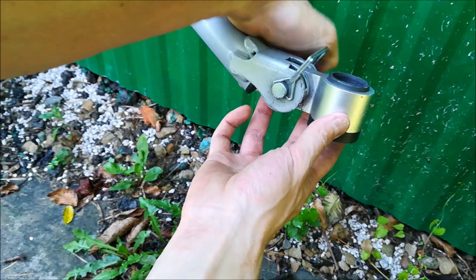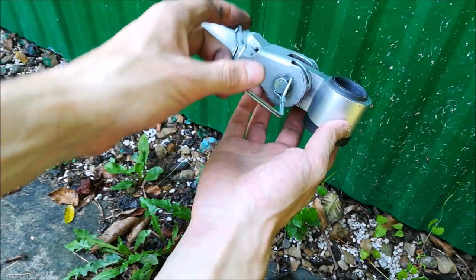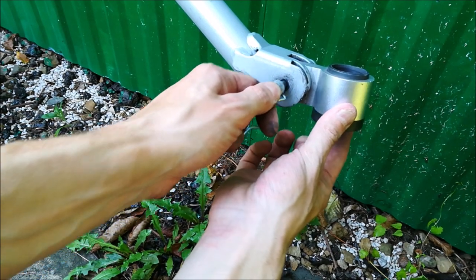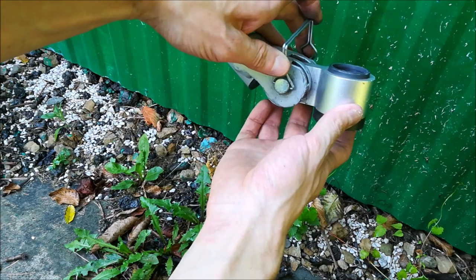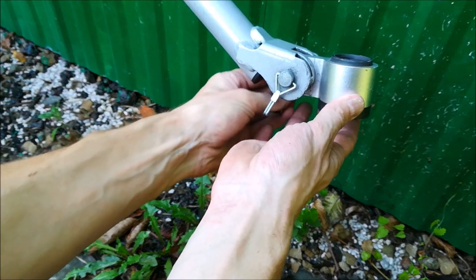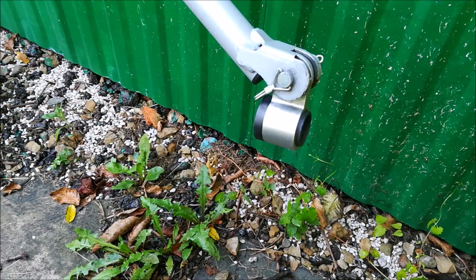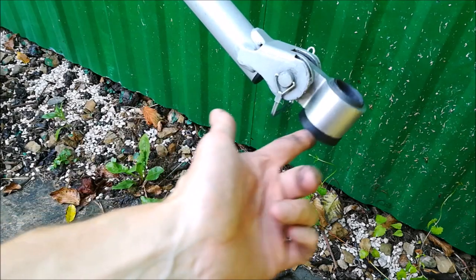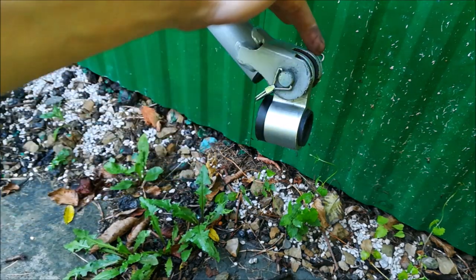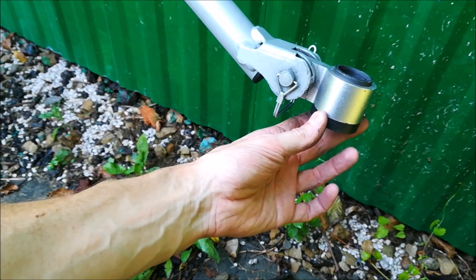This trailer had two such pins with a safety wire, and one doesn't exist anymore because at one point the safety wire simply broke and the pin could make its way out of this hole and detach the entire trailer. If the safety pin is in the lower position, then the same force that forces the safety pin here is going to cause it here, and nothing happens. And since the user manual doesn't tell you that, you have a point of failure here, which is a 50% chance of something happening. Obviously, you should take precautions when riding anything to check whether it's in sound technical condition.